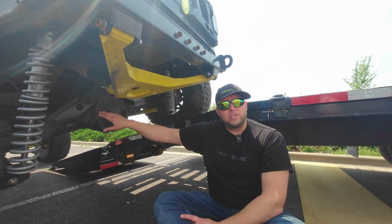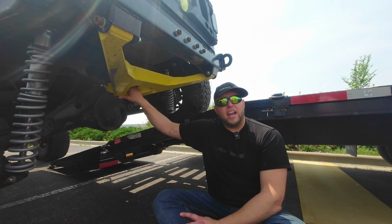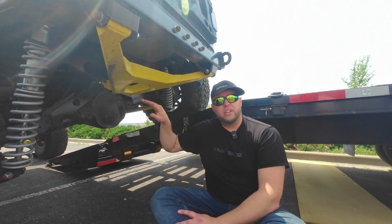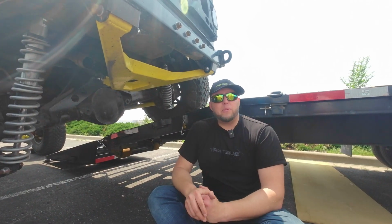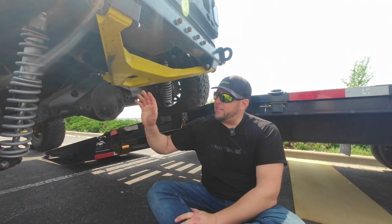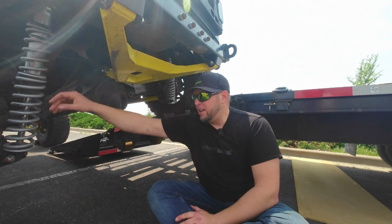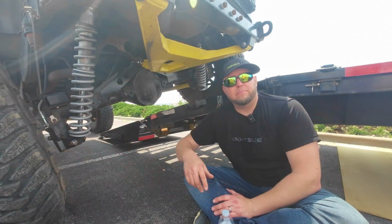So you get lower arms and long travel low arms forward of the stock axle. You weld on the truss. The pinion on here does your triangulation, and this travels with the full axle perfectly inside the wheel arch. So 100% tuck, probably better than most people get set up on their rigs when they do 60 swaps. And then the coilovers bolt on to the stock locations at the top, and you would just have a reinforcement bracket down here at the bottom.